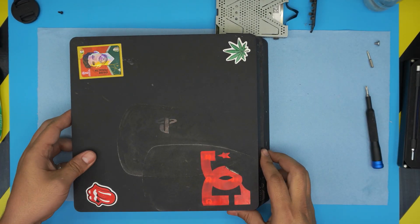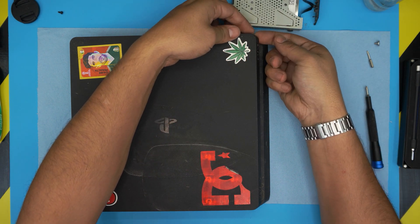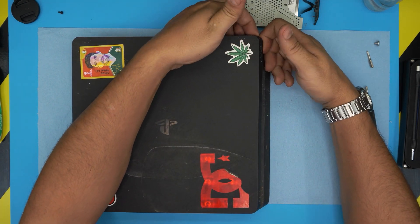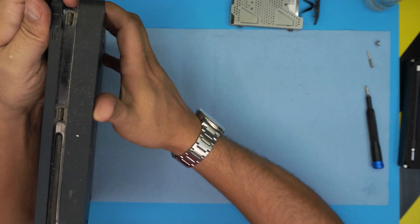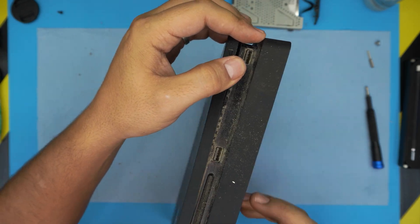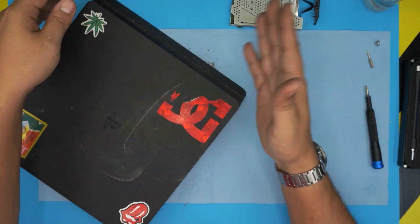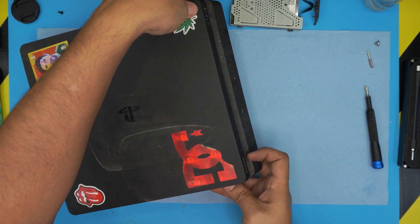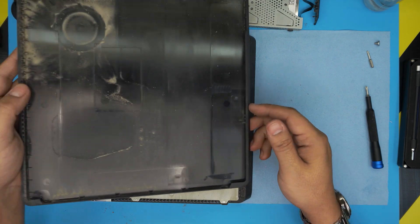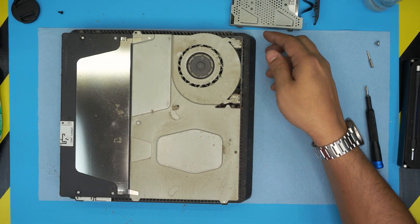Set the hard drive down. Now we're gonna remove the top plate. Put your fingers at the edge of the front end, right where the PS4 logo is, and just lift it up. Don't force it too much — just lift from the front corner and open it up gently, then slide it up. Holy crap — you can see all the dust on the cover already.